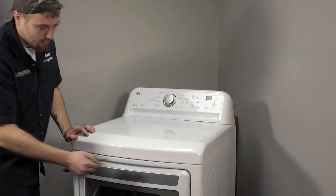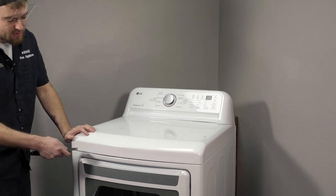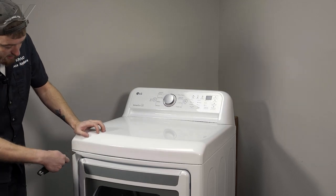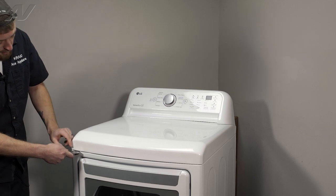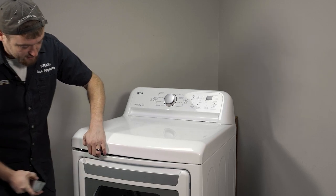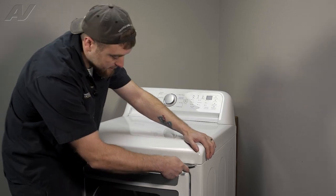On the corners, they put a small triangular locking tab that you have to press in with the putty knife and lift up. There's not a lot of room to see exactly where it's at, so use just the corner of the blade — the full blade will not be able to hit it. Go about an inch in, press in, and start to lift up. You should feel it bending, and then you can see right where it's at. Once you get one side up, it's a little easier to see the second side.